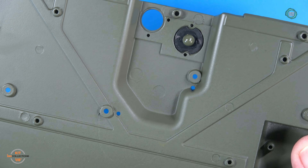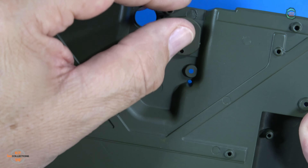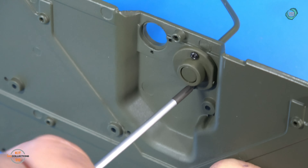Next we're going to bring over these two other plastic parts. This is going to fit over the top of that, and that on top of the lever. We'll line up our holes — we need to put the flat side up against there. Then we put our two DM screws into this. Tighten them both down. That's secure there. Gear shift lever looks great.